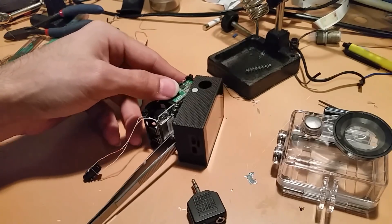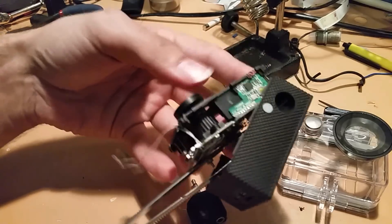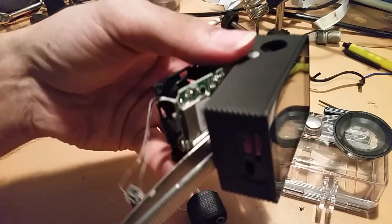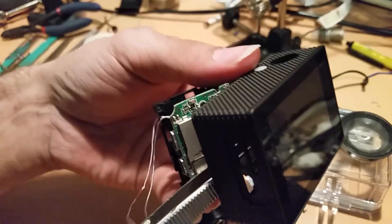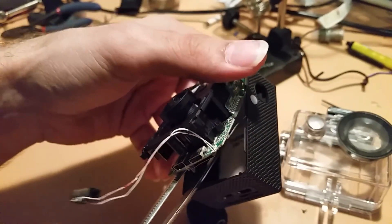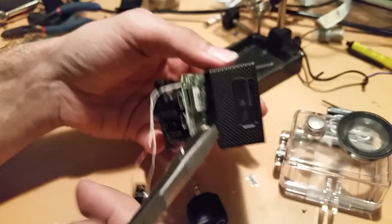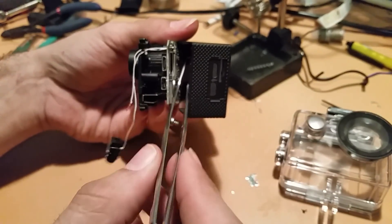But also not to put too much pressure on the flat flex ribbon cable and the hood, as to break it. So once I was able to get into this angle, it was pretty workable. There is your microphone. I set my solder station to about 230 degrees Celsius, and there was just one more little thing there.